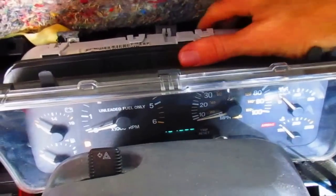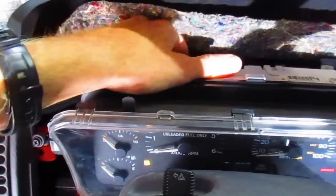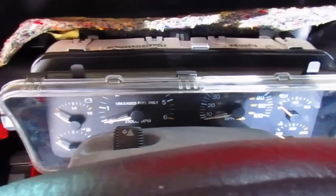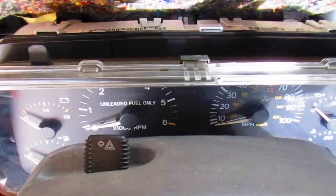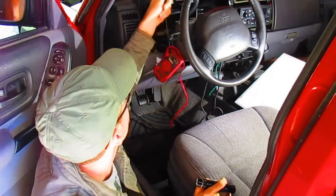It's a computer problem. So we got power, we got a gauge check. That's all good. Why is this thing deciding to just keep beeping? I think it has the headlight switches out. Let's go back to the wiring diagram. So it seems we found the location of the ground finally. G108 is down under the dash here somewhere, probably buried and hard to get to.